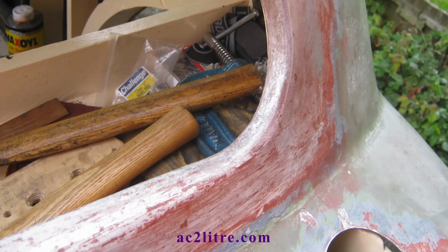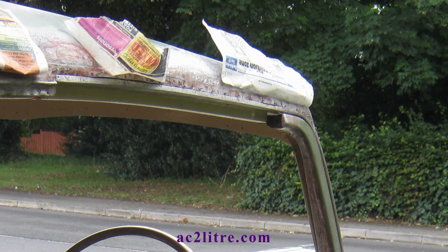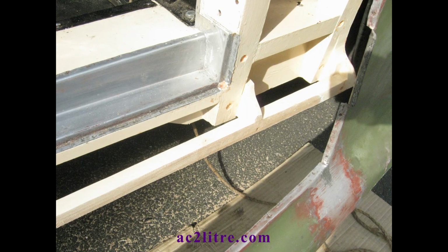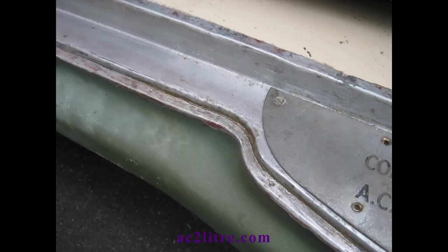Finally, I folded over the bottom edges of the rear window opening, which lifted the rear end slightly. I then hammered nails into the gutter nail holes temporarily, and these gradually forced the shell forwards. That did the trick, and the front finally dropped into place with the panel pin holes lining up. When I made the new wooden sill rail assemblies, it was hard to measure the required lateral position, so I made them slightly oversized. In the event, I did have to plane them down slightly and repaint them for a perfect fit under the panelling.